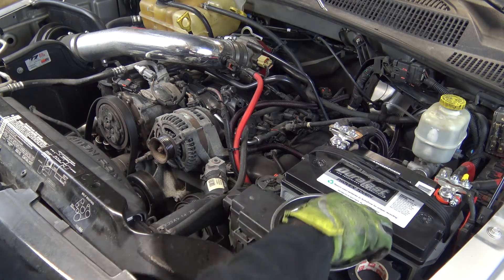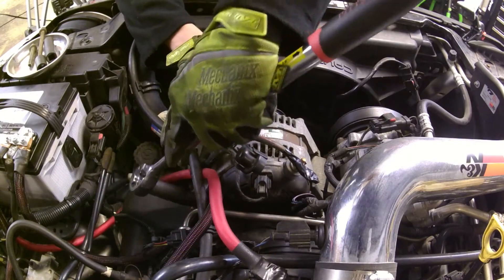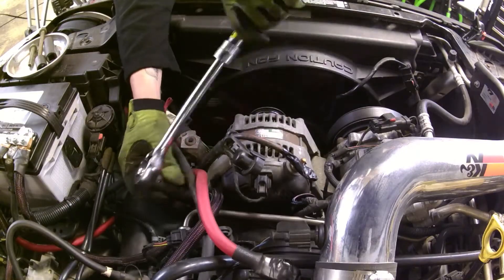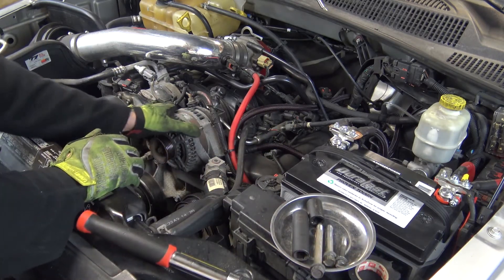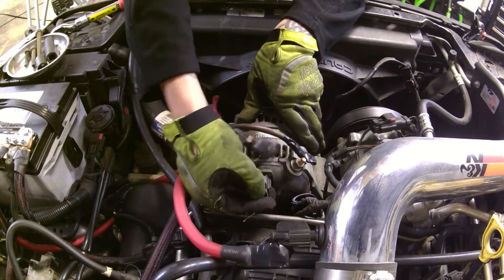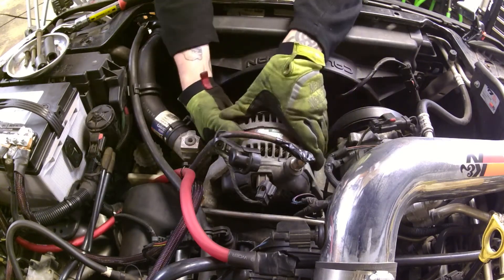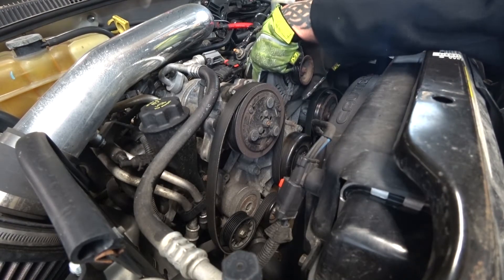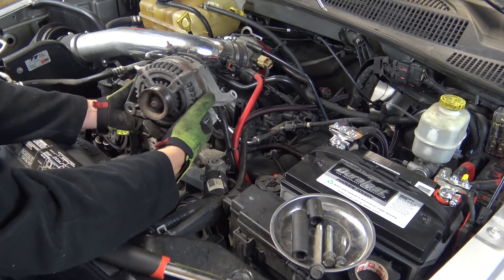Our next bolt is a 13 millimeter. On mine, I have a really large ground cable — actually two large ground cables. You most likely won't have that unless you've upgraded your charging wires and your grounds. You're going to have the three bolts and they're each going to be different lengths. Once you have those removed, the alternator is pretty much going to hold itself in place. But you also have a plug on the back that needs to be removed — that would have been better as one of your first steps, but since the alternator doesn't just fall off, it's okay here. You can wiggle it out by hand — just try not putting your hand down in here because you can and will pinch yourself. Just gently wiggle it back and forth and it will come right out.